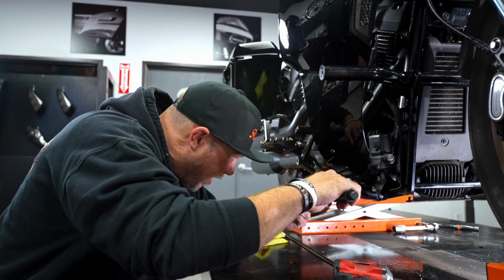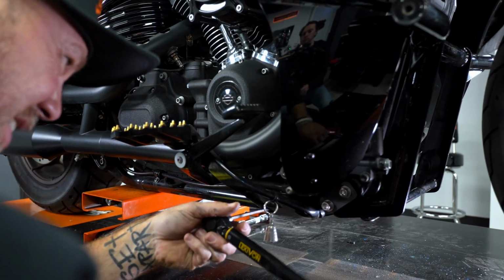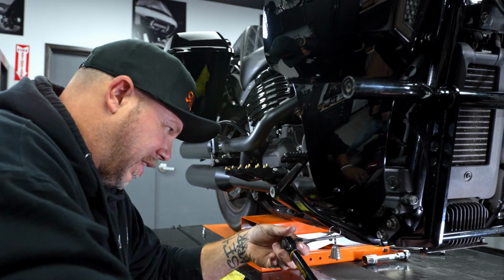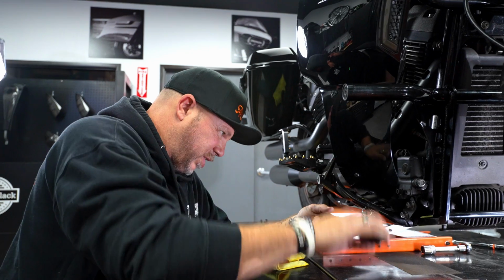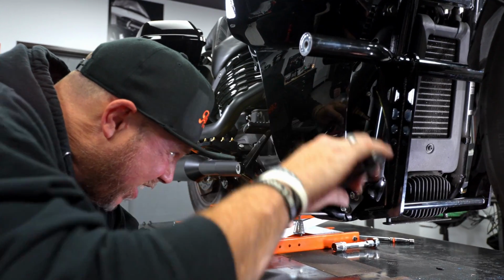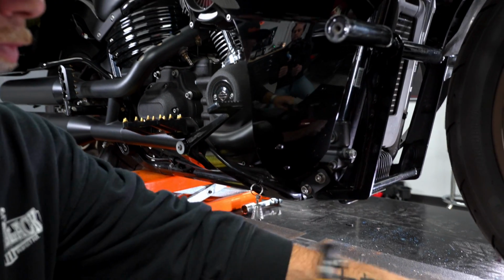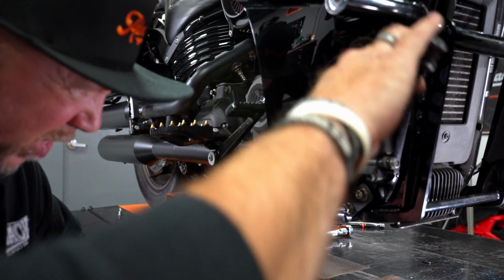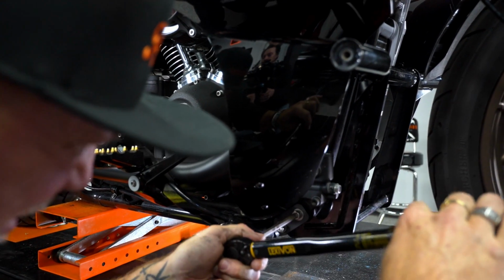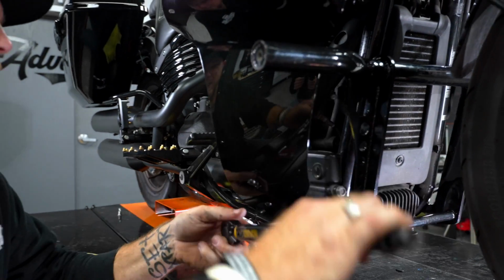So we're back over to the brake side, and we are going to go 15 to 20 foot-pounds. I tend to stick with the higher levels. I know a lot of people split it. So 15 to 20, what's that, 17 and a half? I think I'm going to run closer to 20. There you go, there's 20. And then the front 2. And brake side's done.